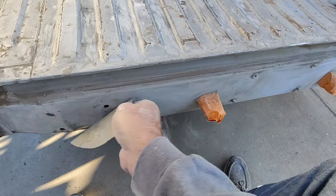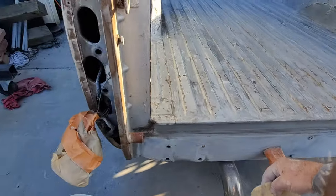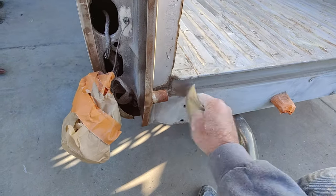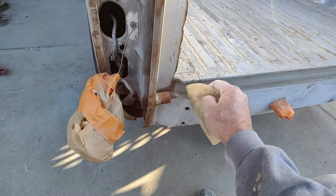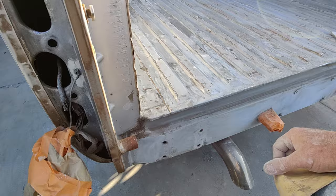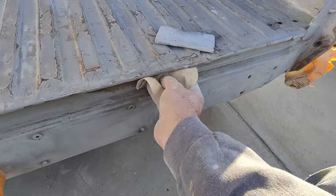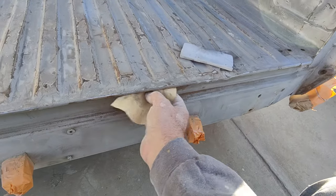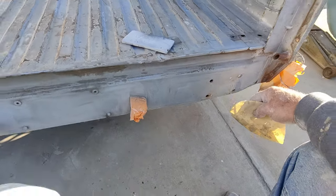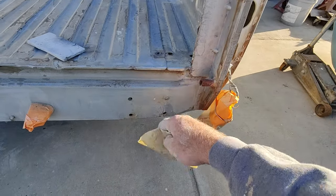You use clear binder. What I'm going to use is another base coat, because I'm doing this whole car with a quart. One quart of the exact color. Now, what I've got is leftover silver. I'm not going to say where I got it. I'm saying, hypothetically, you can buy a cheap base coat for about $100 a gallon, silver. Shoot the whole thing with extra binder in it. What that does is fill a lot of these scratches. Fill it up really good.